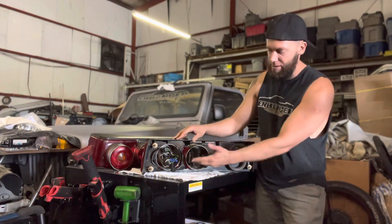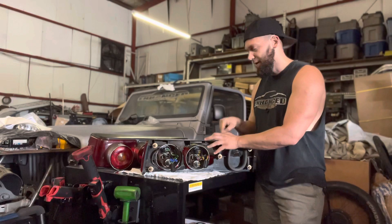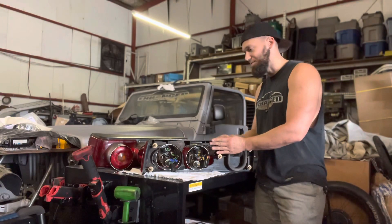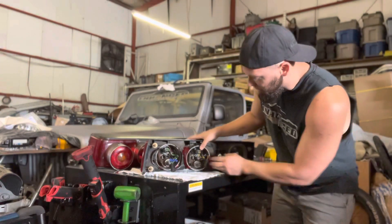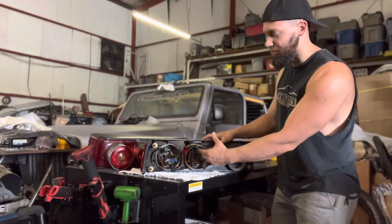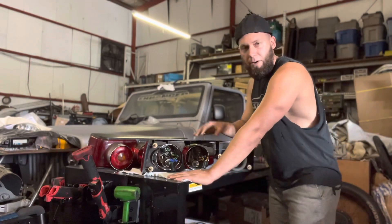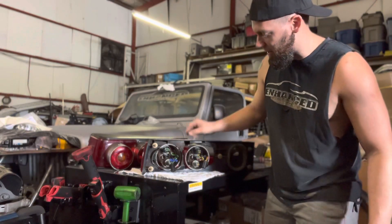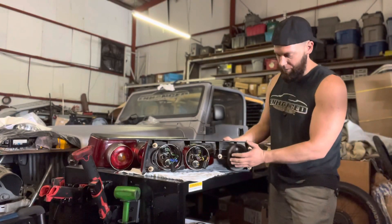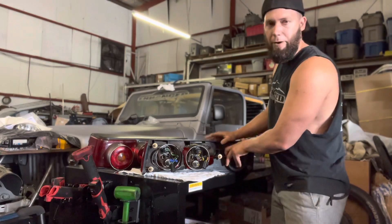Technically I should never have to get in there again, because if I need to pull the tail lights I can just take out the nuts and pull the whole tail light out from this right here. So I'm thinking when I put it all back — the lens and the housing back together — I'm going to glue it 100%, so the lens and housing will never come apart again. I'm also debating putting foam on the inside, just in case any light goes through, or light from the interior hits it. I might try to foam-spray some foam in there to give it like a solid insulation barrier.